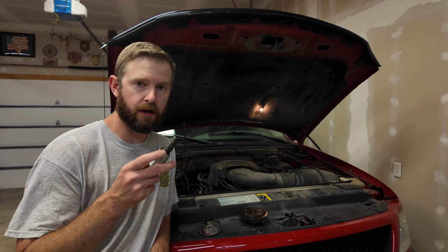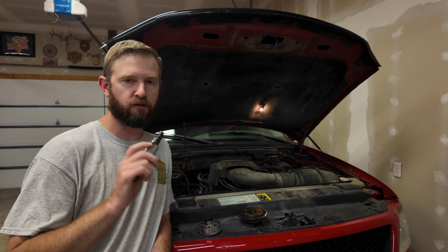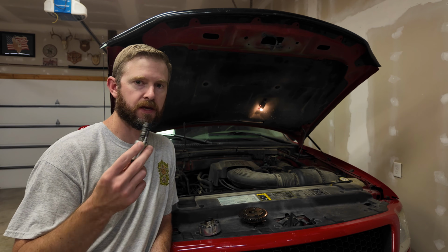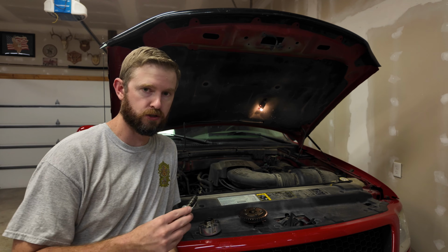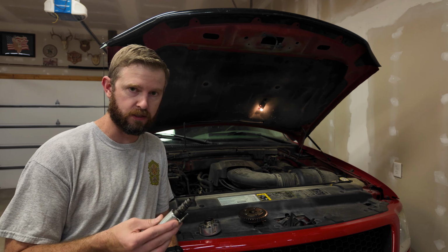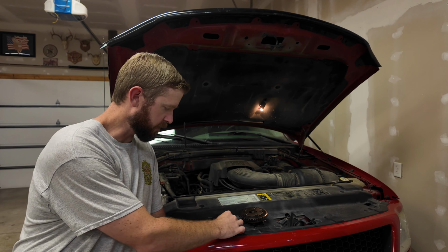These systems require at least 25 psi oil pressure to get into the systems to work. Now, Ford has come out with new solenoids, I believe, that require less oil pressure. But once again, that's just kind of band-aiding a problem that exists with buildup plugging the screens in the first place. So you start getting those things plugged up.